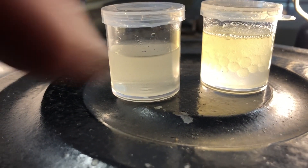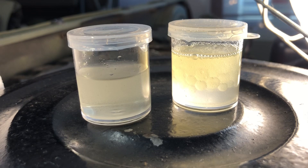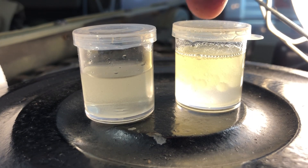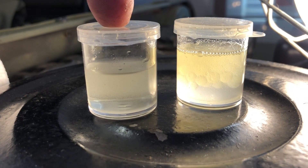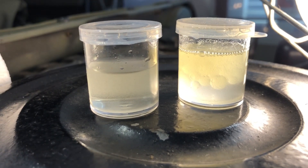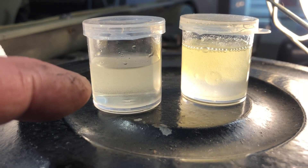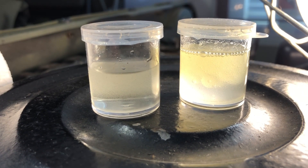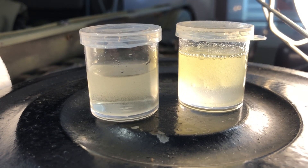You can see what I'm talking about here. This is what I pulled out of the vehicle. You'll notice that the water is separating from the actual fluid — this confirms that I do have a DOT 5 silicone fluid in my system. This is straight DOT 3, regular brake fluid, and you notice that the water has just blended in with it. You do not want this stuff in your brake system because if you have steel lines, this is what causes a lot of rusting. I did a little research this morning on this, heard about the test, and wanted to do it just to confirm what I had. Now we're going to go ahead and add fluid in the system and bleed the brakes.